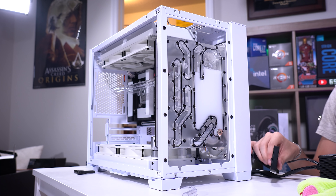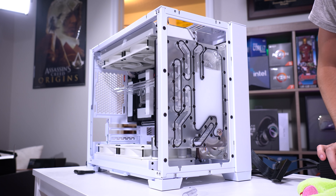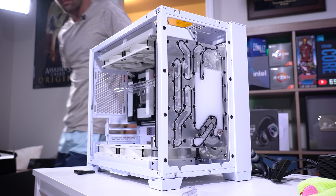We've got our extra power supply jumped at the 24-pin - you could use the one already in your rig, just disconnect other things. Turning on the power now. At least the pump's not dead. I'm confused why that didn't move any fluid. I cannot believe I didn't notice this earlier - there are actually two closed systems in here and they are not loops at all. It's a dead end. The pump was just pushing fluid into a brick wall.